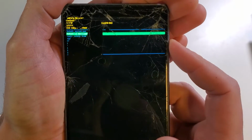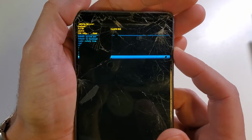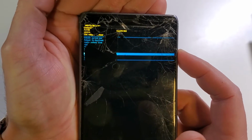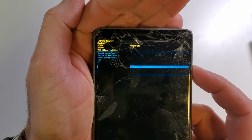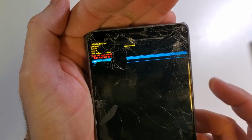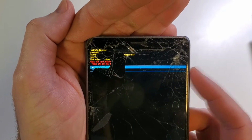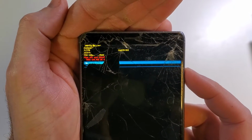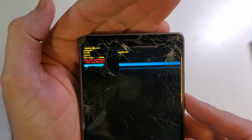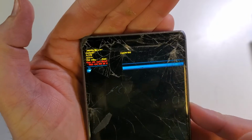All right. I'm going to use volume up to scroll around the other way to where that WI shows up. Right there. Okay, and let's see what happens if I push enter. Okay, the wipe all data, this cannot be undone. That's usually the correct message for the factory reset function. But again, I can't push volume down, so I push volume up to get to yes and yes.